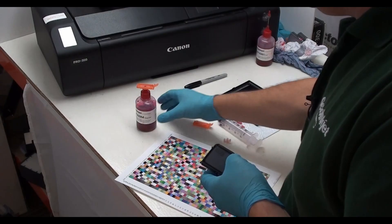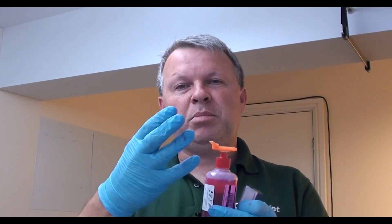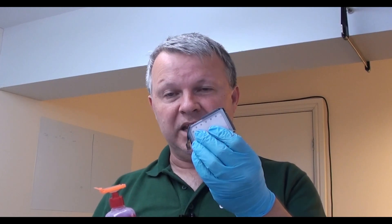If that's the scenario, then you don't want to be running with a cartridge that's partially full with OEM ink, attach your bottle of ink directly to that, start squeezing away, then loosen your grip and have the bottle suck a mix of refill ink and the ink that was already in there back into the bottle — because if you do that you'll contaminate or effectively dilute your refill ink with whatever was in that cartridge. To help avoid this particular problem, we've got a subtle difference on the force fill method that you can use when you first start with a set of cartridges that have had a different ink in them. So without further ado, I'm going to get into it.